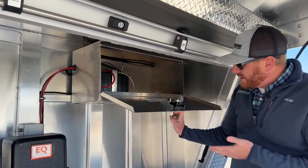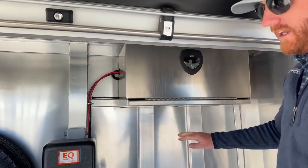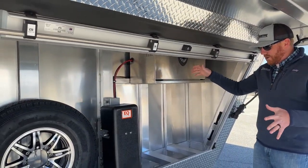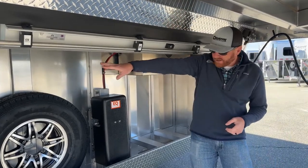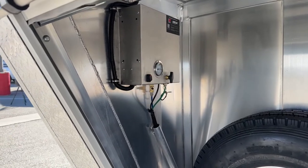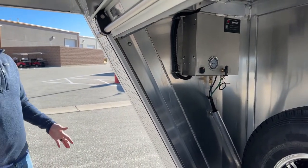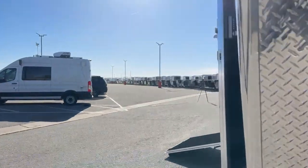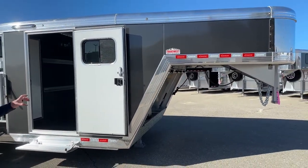You've got the battery box to house a single battery — you can add an additional battery, there's plenty of space. You've got your battery disconnect, which is standard with the hydraulic jack. Now that's standard: if you leave a light on, when you park this trailer you can turn that switch to off and it'll kill all power so we don't drain a battery. The very last thing underneath here, over to the left, is our compressor for our air ride system. It's all self-contained — a real easy system to use. It's on, off, raised, or lowered. When you're pulling this trailer you want that air ride on and in the raised position. You're not needing an external air source on the truck to run this air ride system.